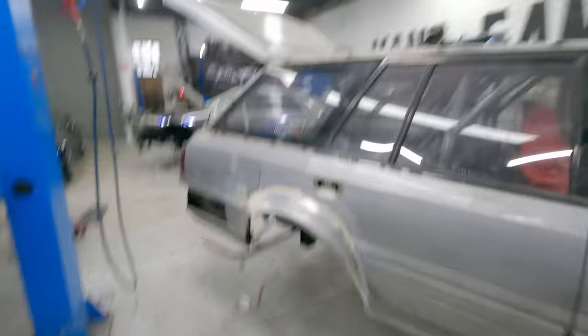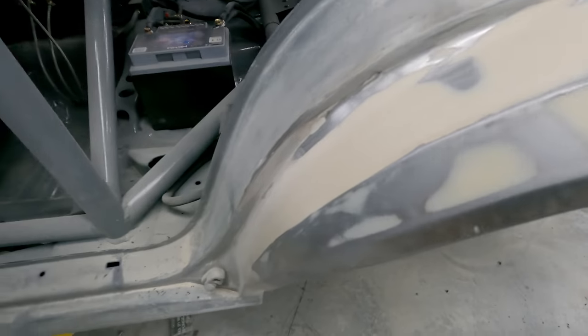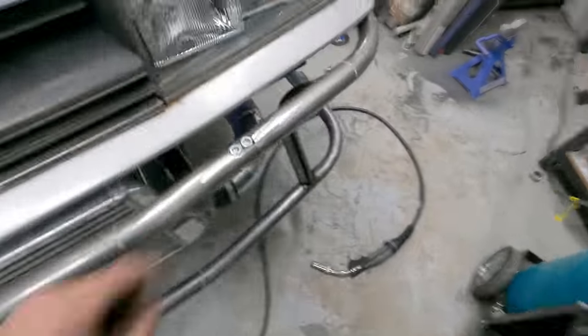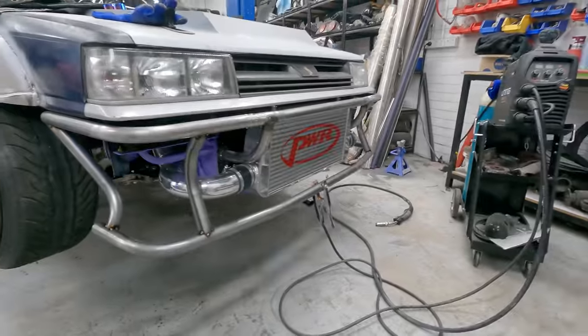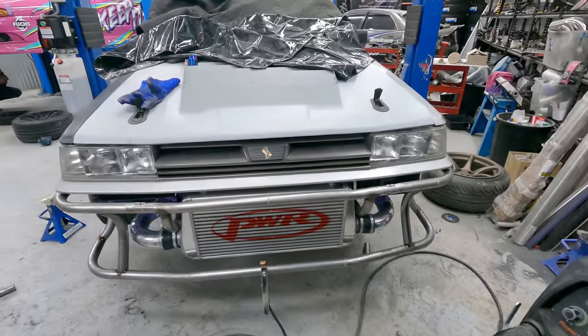The rear guys — molding them in, they're not quite finished yet but getting there, starting to look like they're meant to be there. The front bash bar is all tacked up — had to make this to hold the lip and front bar on, you can't fit the kit without the bash bars. Corey had a top bar made roughly, so I chopped in these roll cage joiners just for flex. This section stays put and bolts on in the back, but the rest of it will drop down so you can replace the sides or whatever if it gets damaged. Looks pretty gangster.